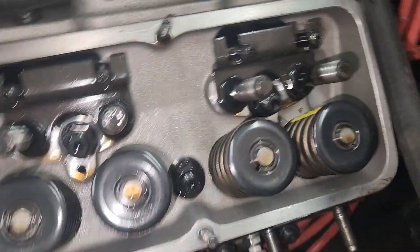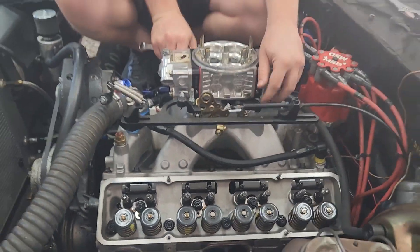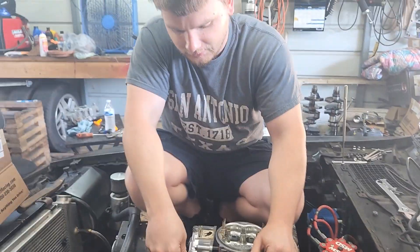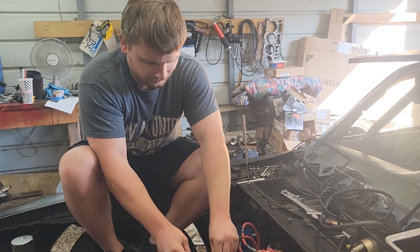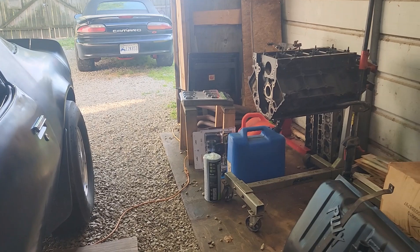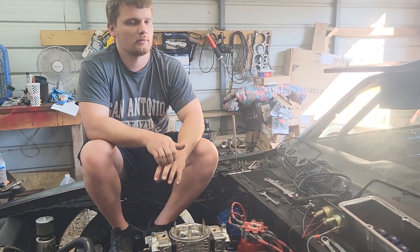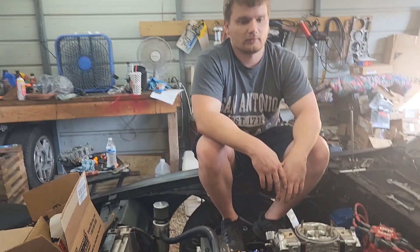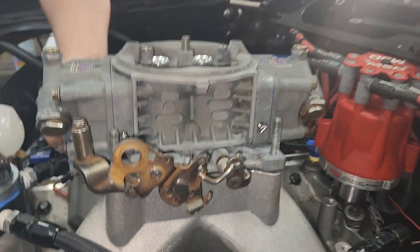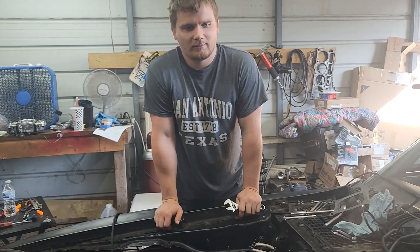This side wasn't leaking, funny thing about it. She's got them new deep wells I bought. We came back through where I have to buy the E85 — it's about a 20-mile drive one way, 40-mile round trip. I forgot to take the gas jugs with me, but those still had gas in them from this car anyway. The 50cc accelerator pumps are hitting, so we're going to have to go get a spacer. Probably should run a spacer anyway — I hear they help. Hopefully Advance has one.